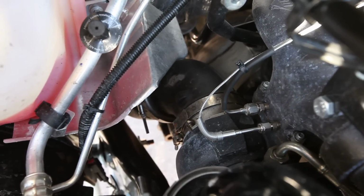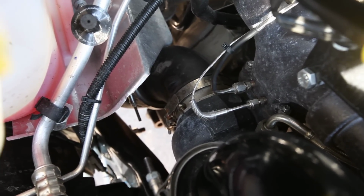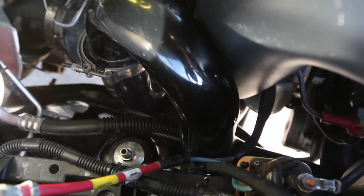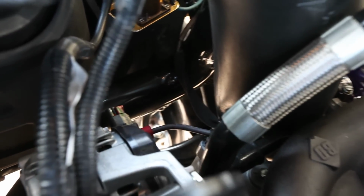You see it's got a 5.9 elbow going to the 5-inch exhaust. And the reason is because the 6.7 liter elbow was a little bit too small. Got a custom ATS hot side boost tube here that runs out. There you go, you can kind of see it there. Runs out of the turbo, goes down up under the intake, and it mounts, runs all the way down in there to the intercooler.